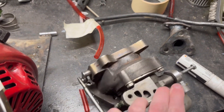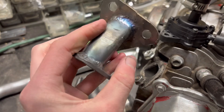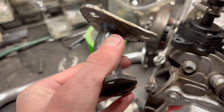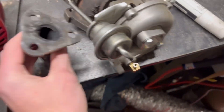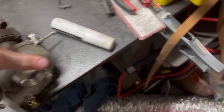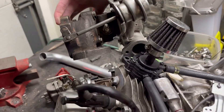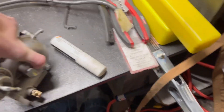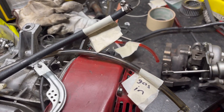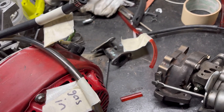I have to get a new one. Next, connecting the turbo to the exhaust — we have a custom TIG-welded exhaust converter, normal stuff, and this will go on the turbo. The turbo sits just like this and the intake is shot over here to the carb. The main thing is you want to do a blow-through setup because it keeps everything pretty nice, neat, and cool looking because you can see your compressor.